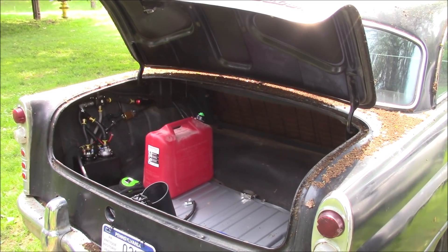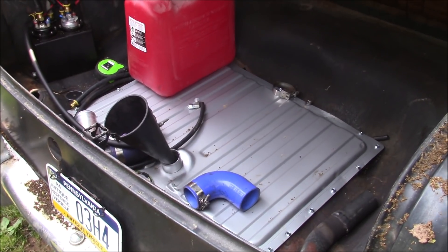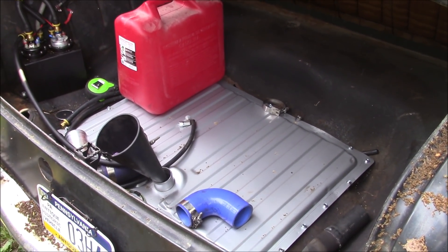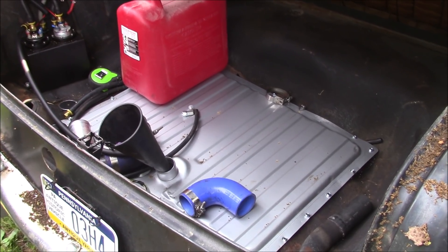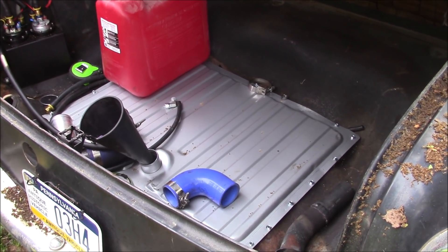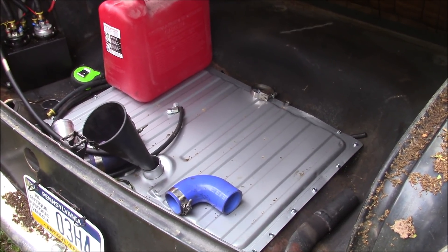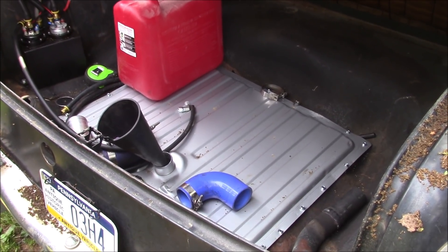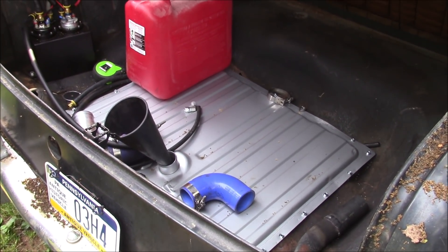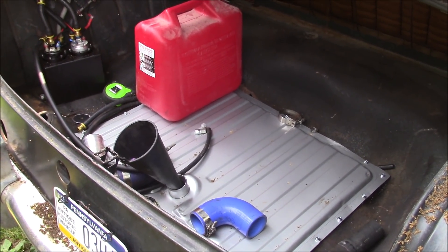It just went to hell. You can't buy a Checker tank - there's some website that sells old stock but it's like $700. I got a '65 Mustang one for $59. I checked and it's actually the same resistance for the sender - a Ford style where it's like 70 to 10, kind of backwards. The gauge isn't working now, but both senders checked out exactly the same.